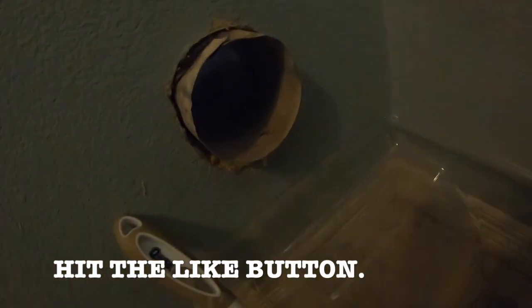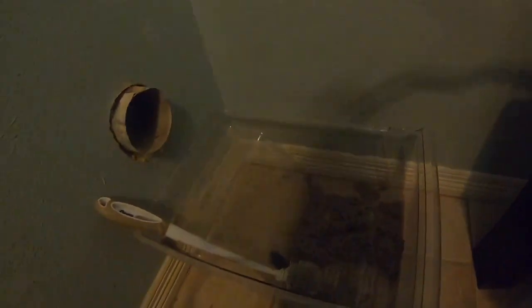All right, guys, here you go. So just a quick little snapshot. We finished cleaning out the duct, and a little bit more lint in there than I actually thought. We took the other hose outside, blew it off, the flexible hose, walked around to the end of the house, made sure there was nothing keeping the outdoor flap from working properly. You can actually see inside there, see a little daylight. So I think we're back to good. We'll see. So more info to follow. We're going to find out why this Samsung dryer is not functioning properly.